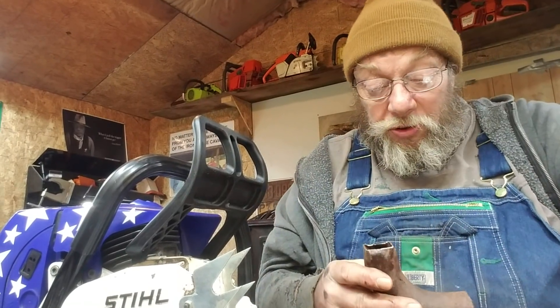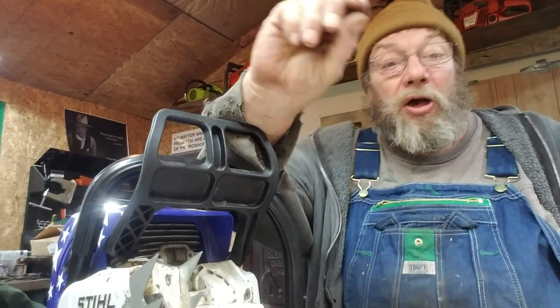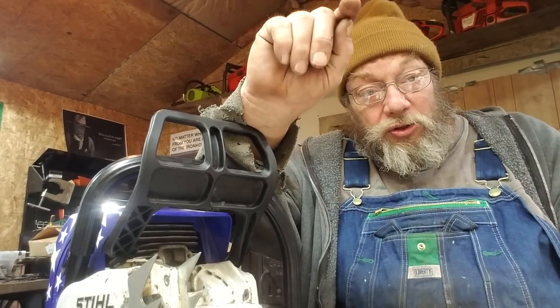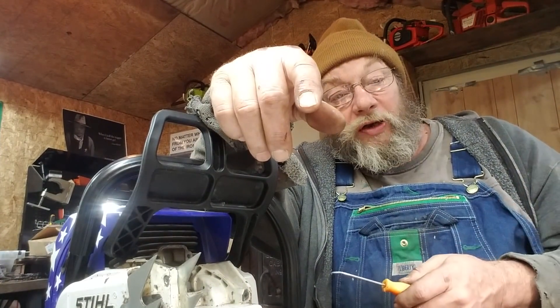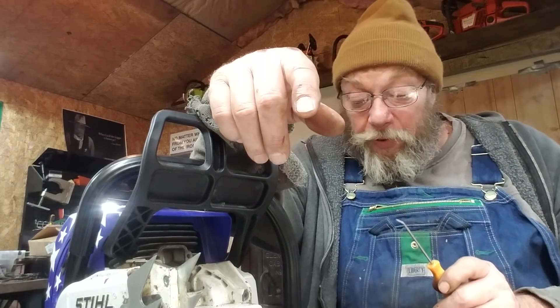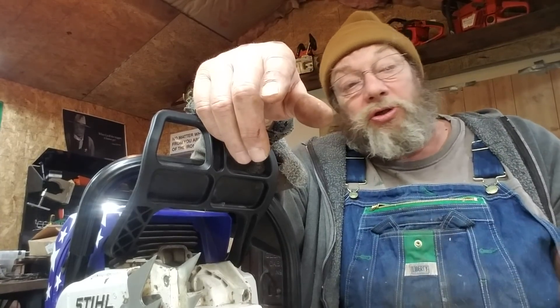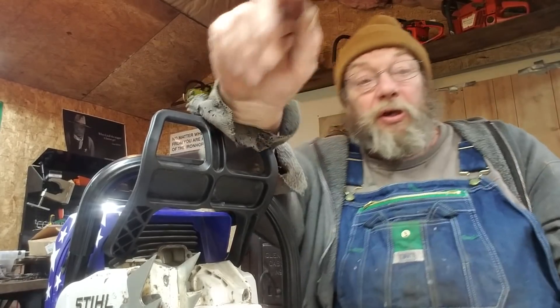I am going to take a piece of stainless steel and insert it right into the exhaust. I'm going to go down about 5/8 of the dimension, maybe 3/4 - we're going to play with that. I want to see if I can get, when that exhaust opens, the main part of the exhaust go out the top, and the air and fuel mixture that after it transfers open comes out the bottom. That's what I'm trying to make happen. And then it gets sucked back in when you get negative pressure - back in impulse, it'll suck right back in. That's the way two-strokes work, that's what makes it pulse. When you get the right pipe, you create it.